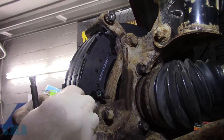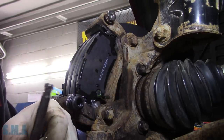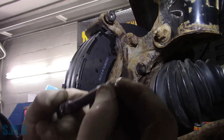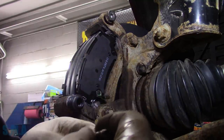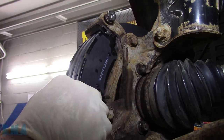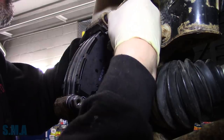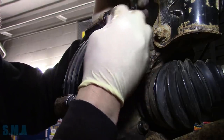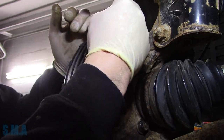Make sure you put the right side in, not the wrong side, and they'll snap right in the groove. We've got a new rubber sleeve for our lower pin. We'll slip that right over the end of our pin, push that on, slide a little bit of our lube over it, and slip that right in the hole. Then we'll do the same thing with the top one - of course it doesn't have that little rubber silencer on there for absorbing vibrations and noise.